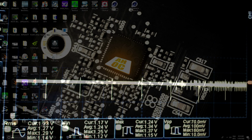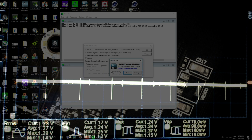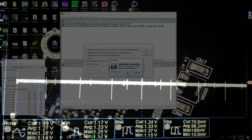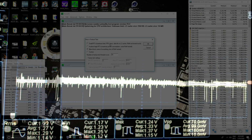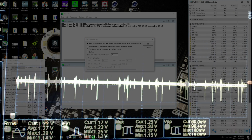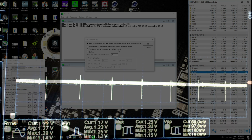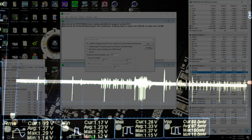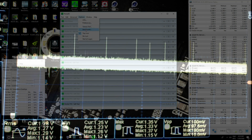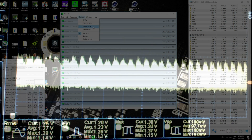So, anyway, we're going to open up Prime 95 and hardware info. I've plugged in the second fan again, because this time I would actually like the slight increase in stability that we get from having the CPU cooler. So I'm just going to run small FFTs. Actually, there's no point scrolling down. We've already seen the VR V-out sensor, where with medium LLC, we're stable. But I didn't want small FFTs. I wanted 32K. 32K specifically is really bad.